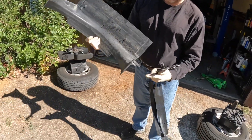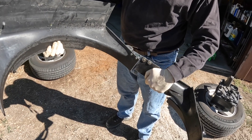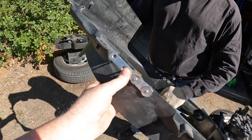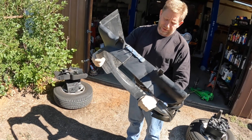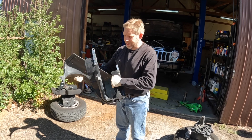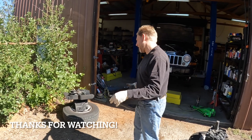On the top side, it's just been cut with some screws that are a tight fit — emphasis on the word tight. When you put this into the vehicle, it just keys back together and a couple of wing nuts hold it tight and keep the ends from flopping around. This allows you to remove the top section, remove the fan, and then remove the bottom section separately, which makes this far less of an ordeal than it would normally be to get the fan out of these CRDs.